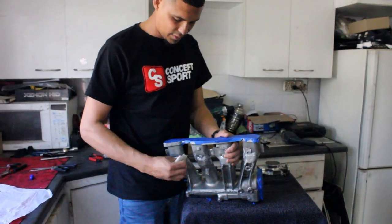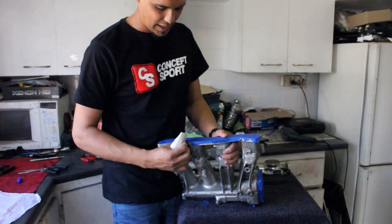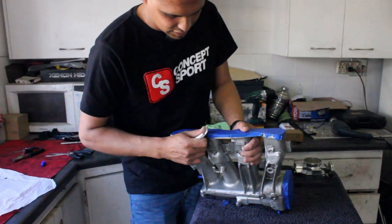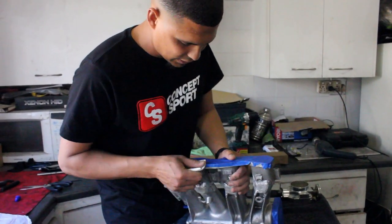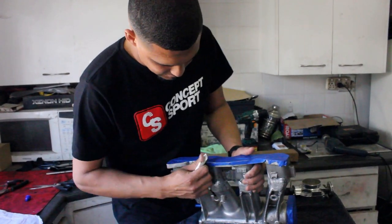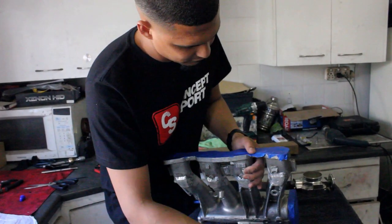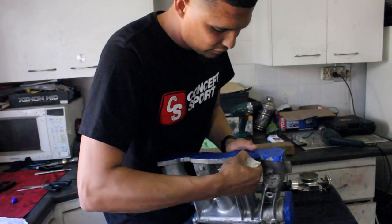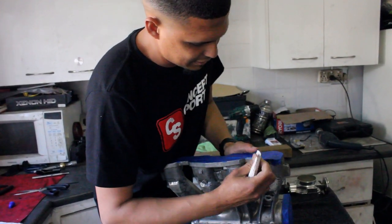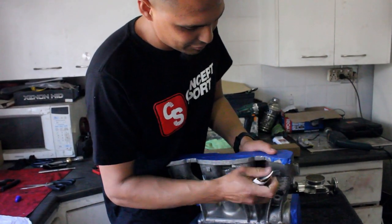And I'm not actually sanding on the intake itself. I'm just sanding it on the edges, not damaging any part of the intake. So then when the gasket goes on, everything is still going to be flush, and there's no interference or scratches or air leaks. Because that's what most of the guys are concerned about. But as you can see, sanding it a little bit makes it come off very, very easy. You might have to cut if you want to, but I just feel like this is so easy. It saves you a lot of time of cutting. This is basically scratch and then you pull.